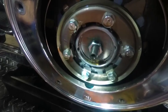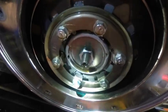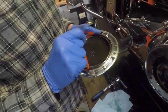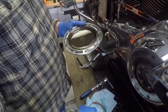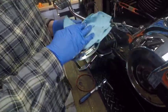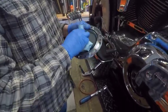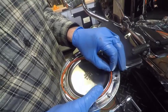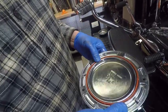You can see down there where the oil comes right to the edge. That's the derby cover O-ring. And this - you can use them time and time again. We'll replace this if you've got one with the kit, then change it. If it's in good shape, that's fine. I just figured it's easier than having a leak. Plus you get your new O-rings with it. You see these little knurls on here - they trap that seal so it doesn't fall out on you. Gives it a bit of friction, holds it in there.